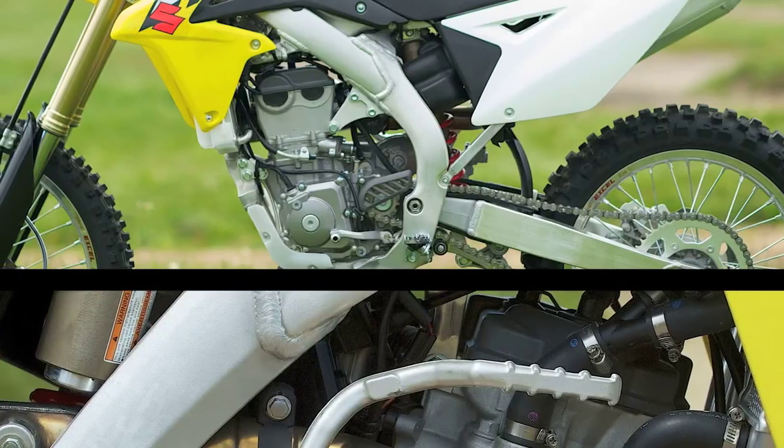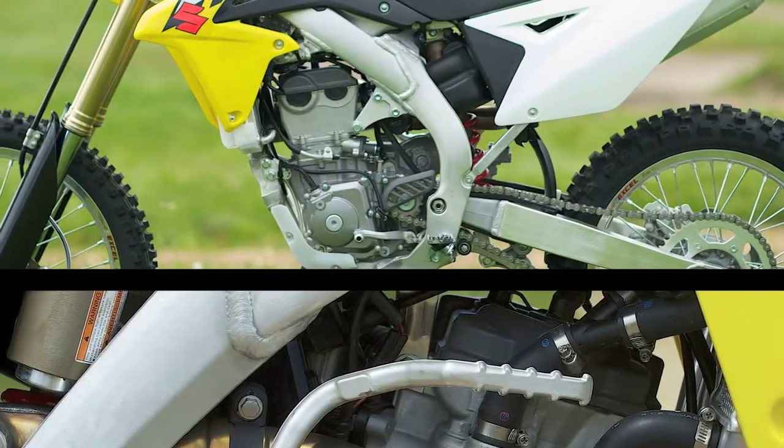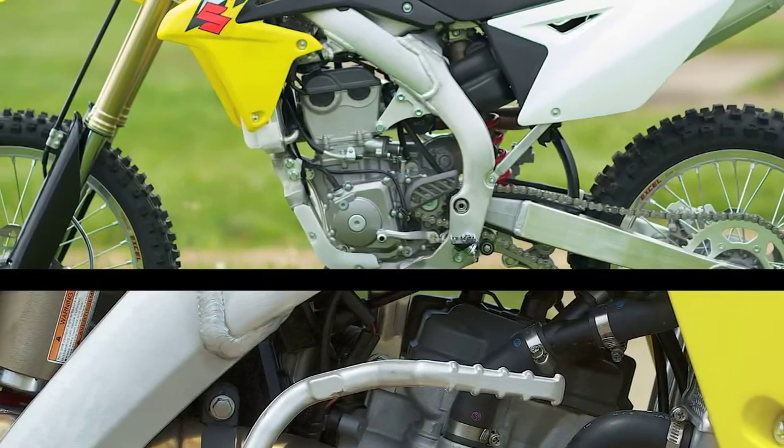The engine and the gearbox on both bikes, they've gone along similar lines, and they've gone for a lighter piston with the new coating and stuff, and they've also changed how the intake cam works, as well as the outtake cam chain and things like that, just to try and give it that little bit more torque and mid-range, I think. That's what I noticed especially on the 250. So it does rev out really well, and it's a solid engine. I just found that the mid-range was probably the best, which is a pretty smart move if you think about the general public and what they're going to want.